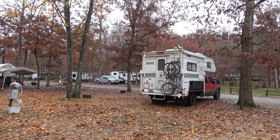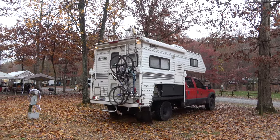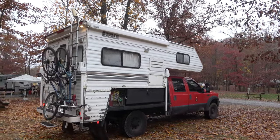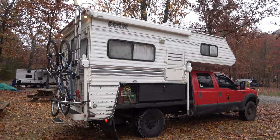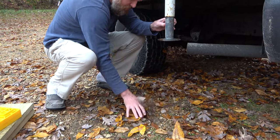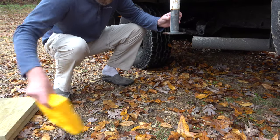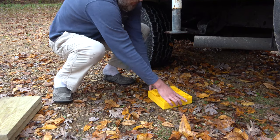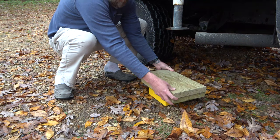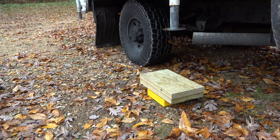The first step is going to be to try to park as level as possible. While you do have four jacks that can go in varying lengths, you want to try to start out as level as possible. Be sure to turn off the truck once you've got into that level spot. Be sure to check that the area where your jacks would hit the ground is relatively level and stable — make sure there are no holes, rocks, or other debris that could interfere with the jacks making contact with the ground. Line up the jacks so that they hit solid ground, or use wooden blocks or leveling blocks.